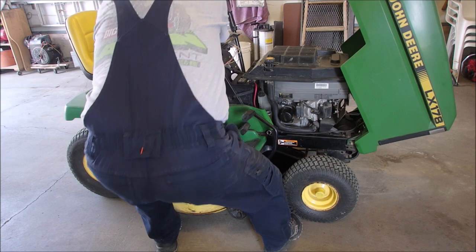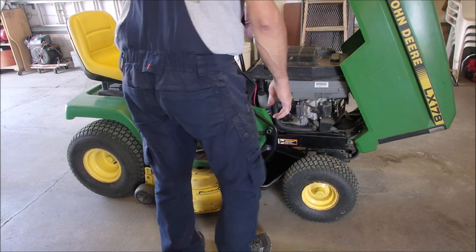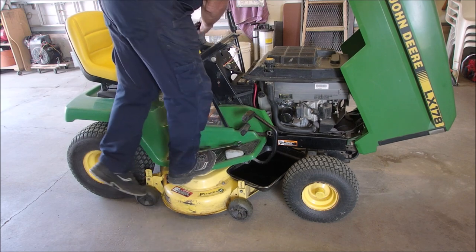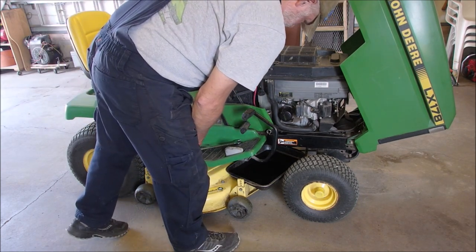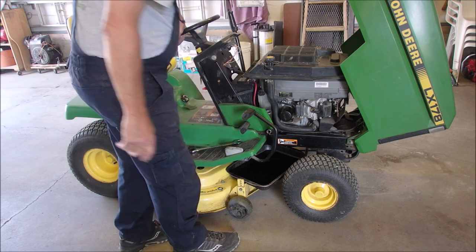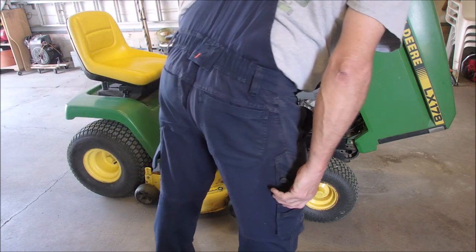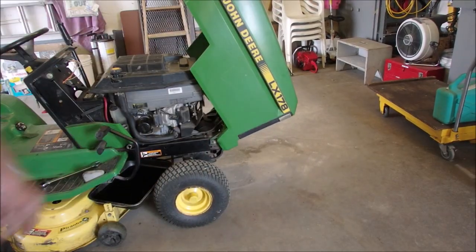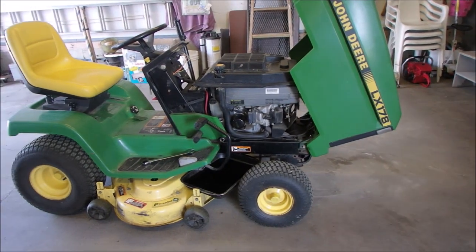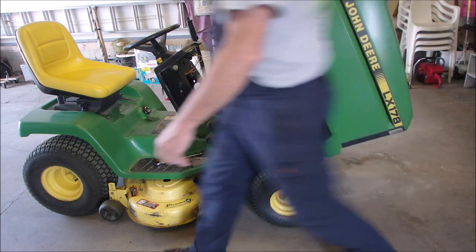I'm gonna pull on it a little bit. Stand on it. Oh, more came out again. Stop, get off and see if it stops. Pretty much. Cool. Alright. 1.8 liters. I'm gonna use 10W-30. There's some kind of a thing in there called John Deere something, but it's a 10W-30 multi-grade oil they want in there. So now you guys get to watch me get this out of here and over to my 5-gallon pail of discarded oil.